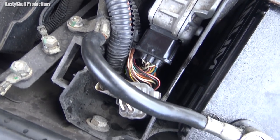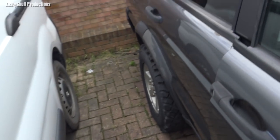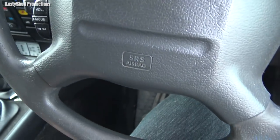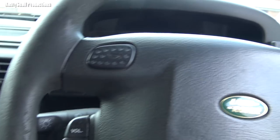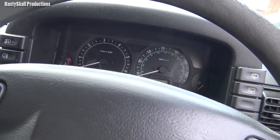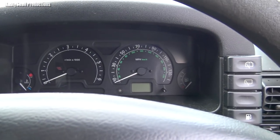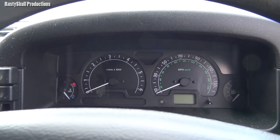There's our old one. New one's all in. ECU's all connected back up. So now we've got to try, well, we won't try, we will hopefully start it up. And then we've got to listen for our misfire and then check for leaks, to make sure the rocker cover seal is sealing and that there's no major leaks around that new plug that we've just put in.